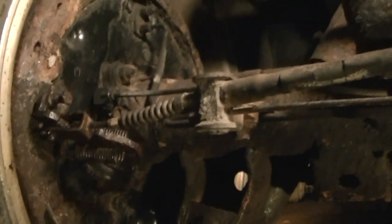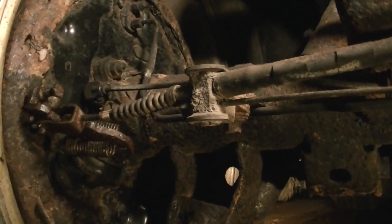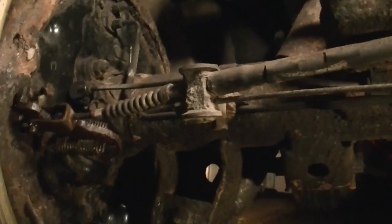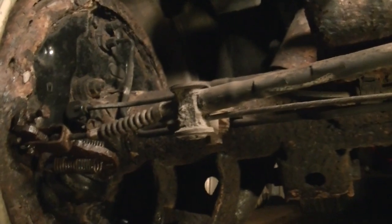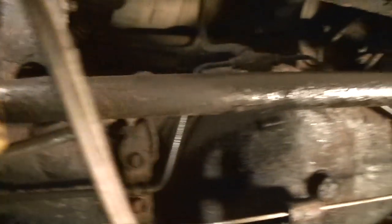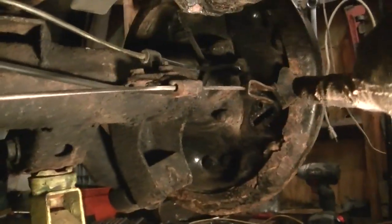The problem is this unit here — this bell crank — is aluminum and it's frozen and completely locked up. So what we're going to do is change those. If we change this one out here, we're going to be doing both sides to make it work correctly anyway. And there's the cable that goes clear across that works the bell crank over here.